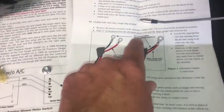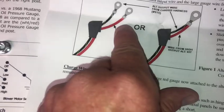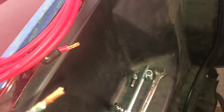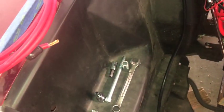It has instructions with references to the Painless main harness. You can see it's referencing cable 915, which is going to be connected to the alternator. If you look at the ends of these cables, they're labeled with the 900 labeling — so this one's 915. I already stripped the end back. I couldn't use my regular strippers on that; I had to use a box cutter and cut the end off. I'm going to cut a little off the ends of these since they're both going into this terminal, and this has a short end on it. Then I'm going to put heat shrink on those and put it together.